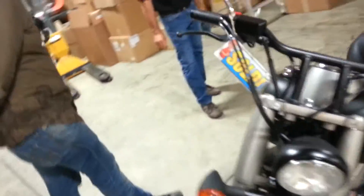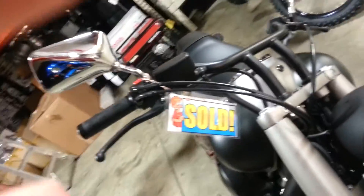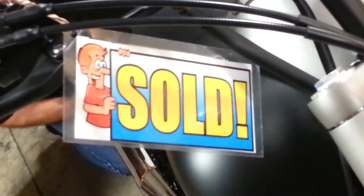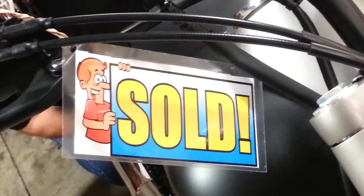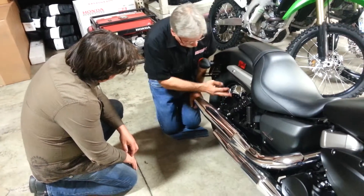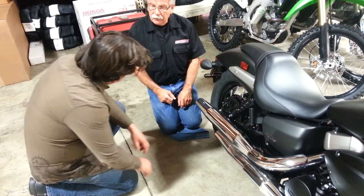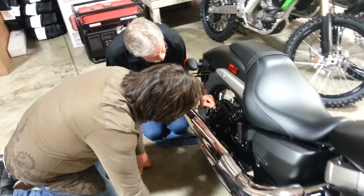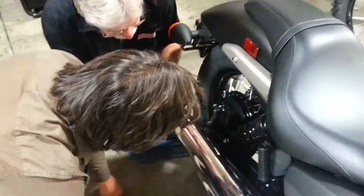Drift out, come down and pull up. There are parts on the back of the plate. When you step on the brake, this arrow lines up with the arrow on this pin right here — and when that arrow and this arrow line up, you have worn brakes. Oh, that's a good indication.